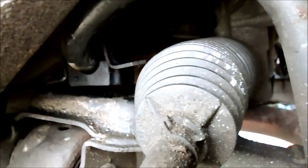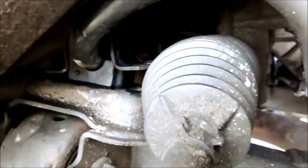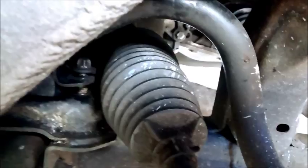Drop the wishbone down. Still need to pull the clamp over and down as far as possible to allow it to meet near its bolt hole. It's a bit of a stretch but it does work - it needs a bit of prodding around just to get it to sit properly. So that's the bolt back in there. You can just grab hold of the drop link and level it up by just pulling the drop link around a little bit. You can get a little bite on it - bolt it back down to tie its position. That's it.